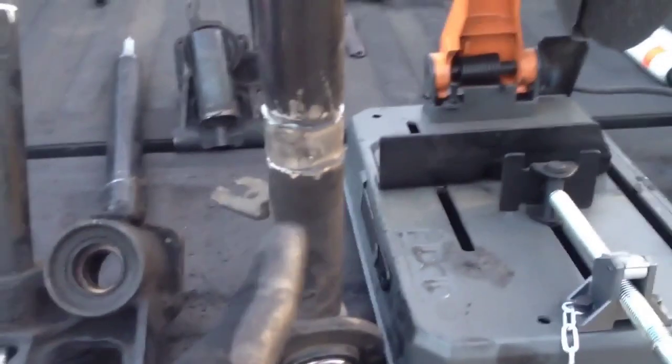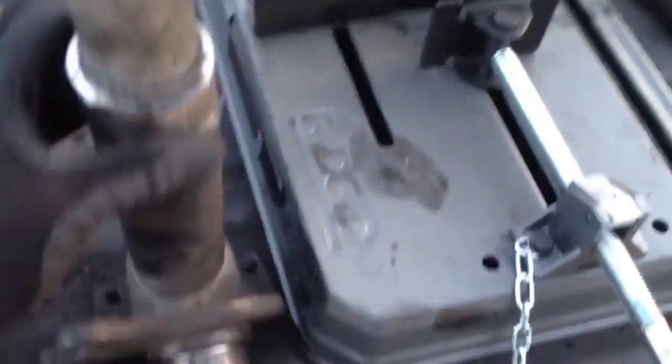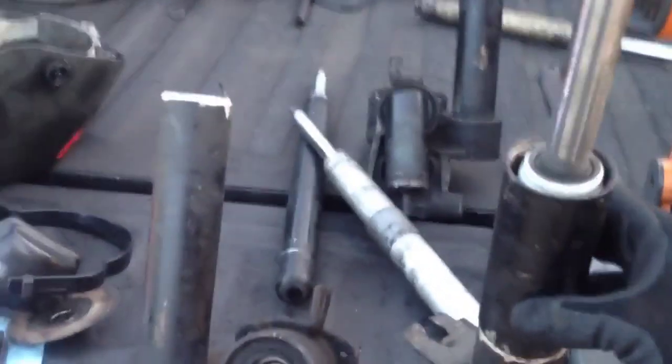It's coming, but I'm trying to finish this. My first chop saw was Chinese-made crap, so I had to buy a heavy-duty one. Here's a stock strut in the front housing — this is basically what you have to do to section your struts. Here's the stock strut. This one's been cut, so I'm just trying to show you. How do you get the measurement of how much needs to come out? Take your aftermarket strut for the front — this is a MR2 front. What you're basically doing is cutting out so that you will arrive back at the same height, so your threaded top will thread in and hold that strut in place.